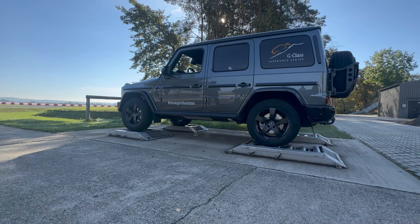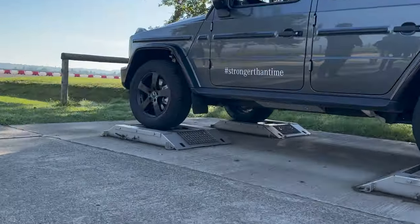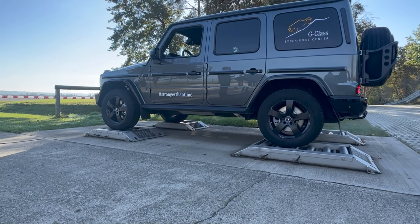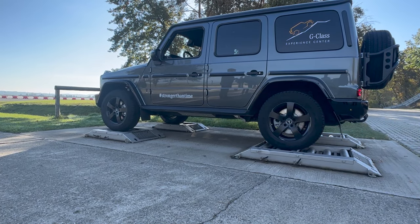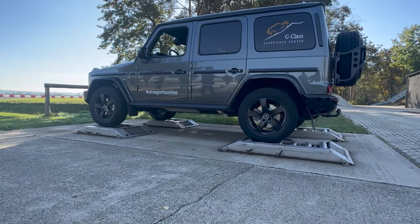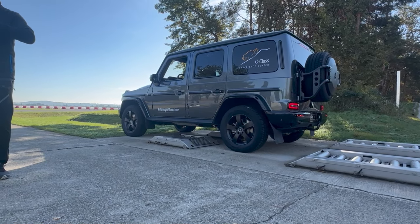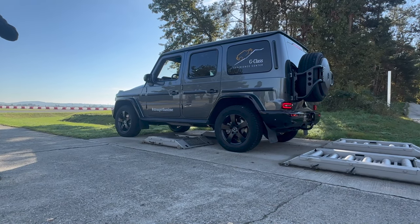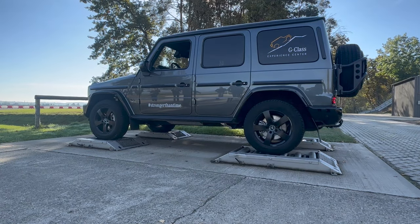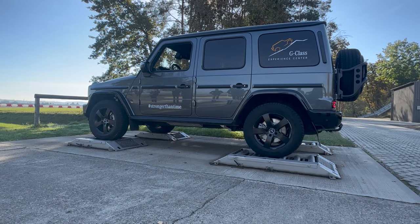So it's standing there — 50% of the power is going to the front, 50% to the back. But because one wheel has grip and the other doesn't, and we have two open differentials in the front and the back, most of the power goes to the spinning wheels. When he releases the brake, the wheels start to turn, the lock comes in, and as soon as it locks it's going to push him off. Now we already have three wheels on loose ground, all spinning through. What can we do?